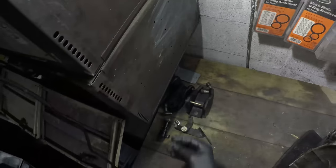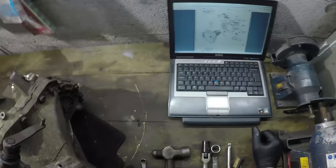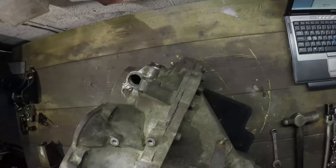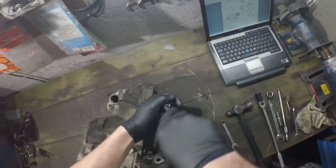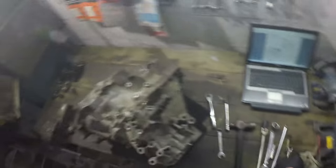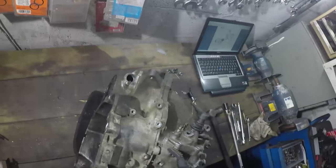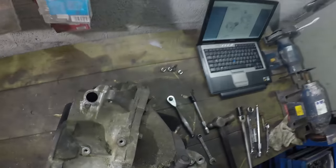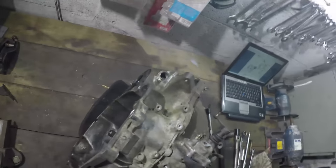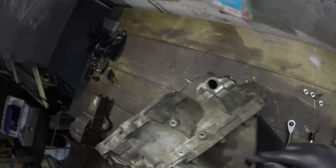We always want to make sure we keep things where we put them. Number 11 is the washer, number 12 is the control housing itself. Looking at what's going on here, we can undo the four 12mm bolts — just get them undone a bit then spin them out with the socket handle. I would expect this is going to have sealant on it — you can see a line of sealant which has been squished out, so this isn't going to come out easily. It's going to want a little bit of persuasion; it looks like they've given you some little areas to persuade it with. I'm going to clean this one off because it's going to leave a large gaping hole inside the gearbox case and I don't want rubbish going in there.